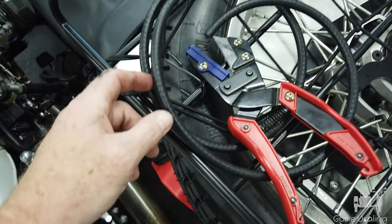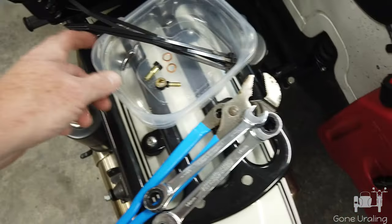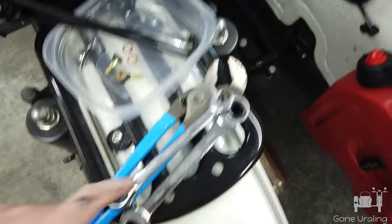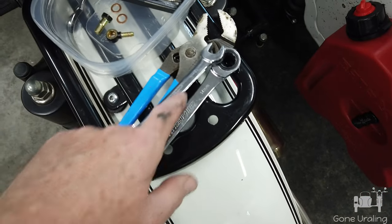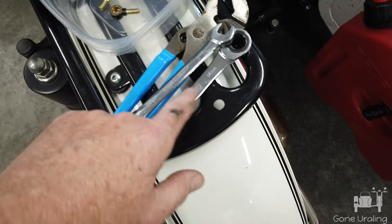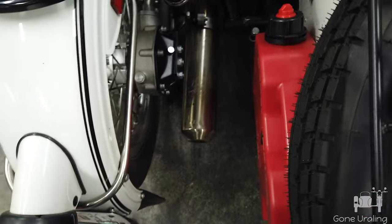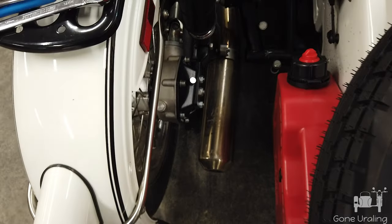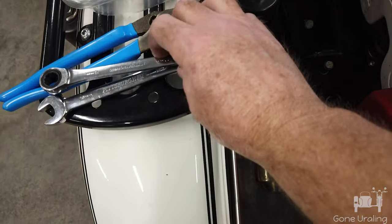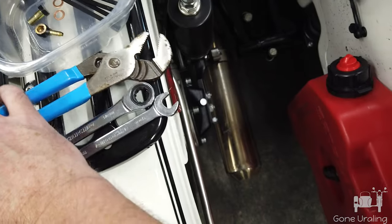A couple hundred degrees at most, and oils, if they get in there, won't deteriorate it. I'll need some zip ties, channel locks — I've got a 12-millimeter, which is for the banjo bolt, and a 14-millimeter, which is for the vent. Now, if you've never removed one of these vents before, it's actually designed to come out — you don't have to destroy it or beat it out. Hopefully nobody red Loctited it for you.